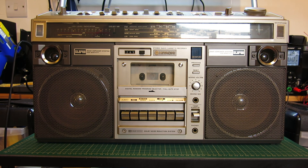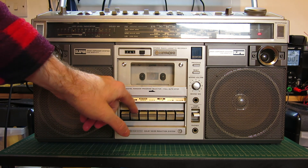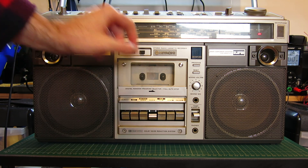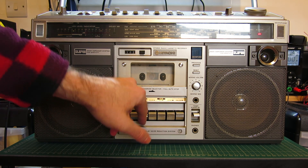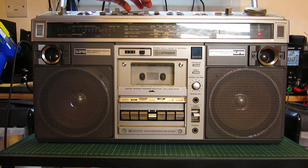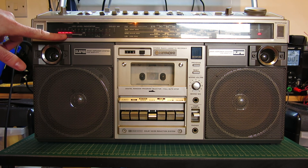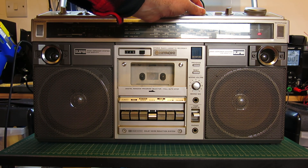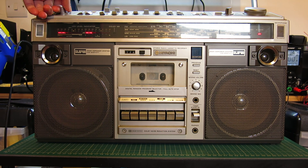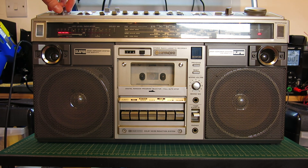There's more to do on this one because it's apparently got a power fault. I've got it plugged in — you can see the power's on. The heads are a bit mucky so I'm not going to put tape through it, just going to see what the deal is. The belts are alright — they work — but they're still going to get changed. Now that's interesting, why is the meter reading so low on AC power? That's way down. Even on radio it's down even more — it's just faded away.